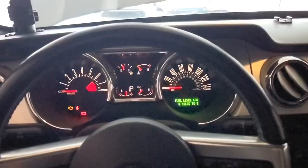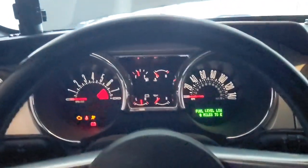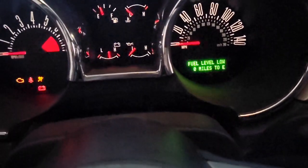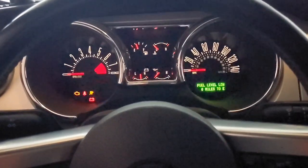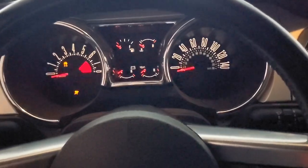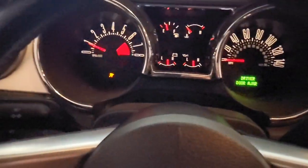I've reconnected the battery again. Now I've gone into the vehicle and put the key in the forward on position - we're not going to start it, and we're also not going to run any AC or any other accessories that take power off the motor. We're just going to leave it in accessory mode for about a minute. Then we're going to start the vehicle and let it idle anywhere from five to ten minutes before we go take it for a drive. We're going to let it idle and I'm going to get out of this garage before I poison myself.